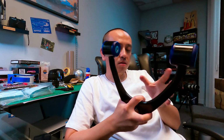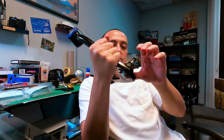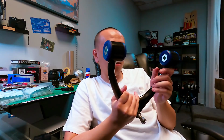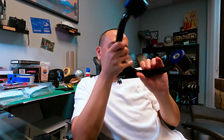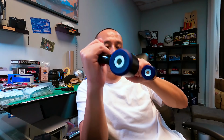But one of the main things is we got these Serial 9 upper control arms. And, you know, they come with the ball joint and everything in place. But we got new bushings. So we have Super Pro bushings that fit right into these. Yuta said it fits perfectly, so it looks great. Hopefully it rides good. And these are actually for JZX applications, so they're slightly shorter than factory IS300, so that'll give us a little bit more camber.